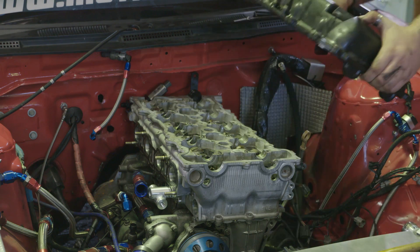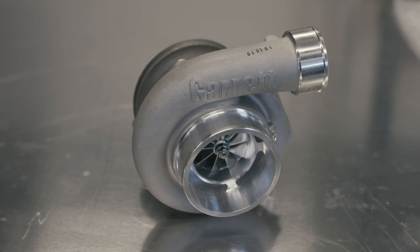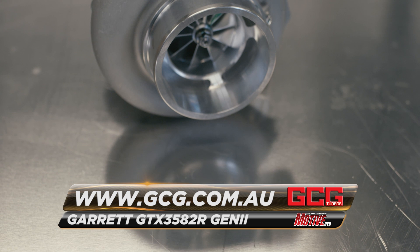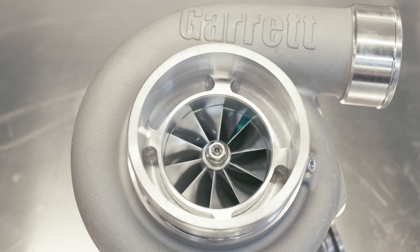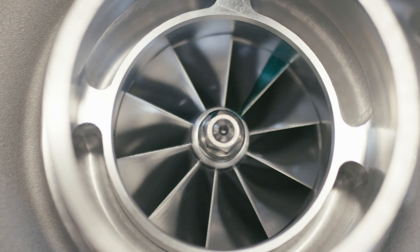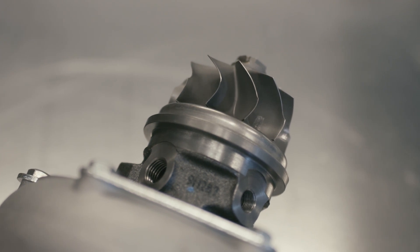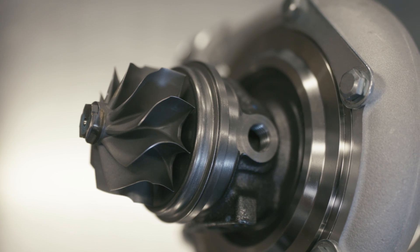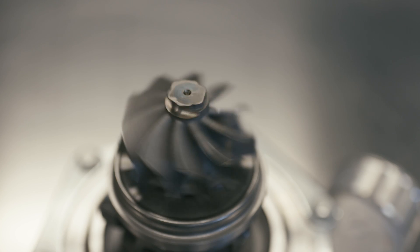With a much larger and more efficient head on the car and the old turbo maxed out, we decided to upgrade the turbocharger — both to a newer model and larger size. We went for Garrett's new Gen 2 GTX 3582R from GCG Turbochargers. The Gen 2 series GTX turbos have a new compressor wheel that can provide as much as 10% more airflow at the same turbine speed. Our old GTX 3576R has the same rear wheel and housing, so the 6mm larger front wheel combined with better airflow means we'll have no problem making more grunt without losing too much response.